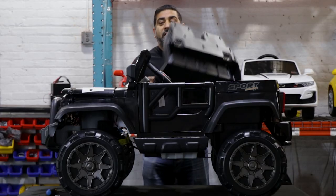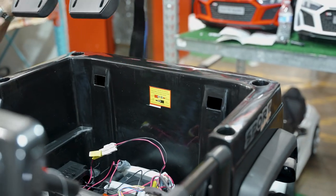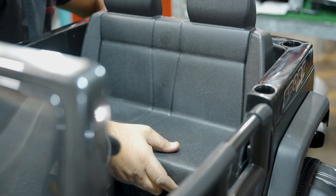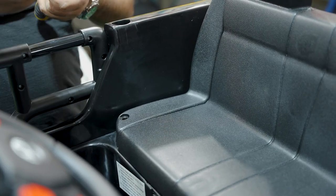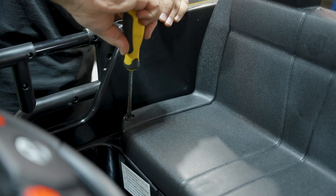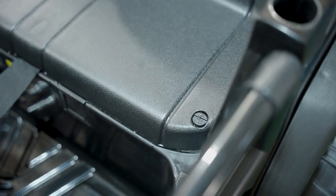Next, we're going to install the rear seat. Make sure the seat belt is pulled straight forward away from you. When installing the seat, there are two hooks — you want them to go into these two slots. After your seat is in place, get the two black pegs, insert them right into the seat, and turn them 90 degrees. Your seat is installed.